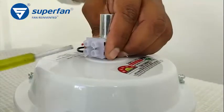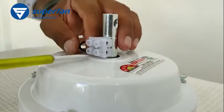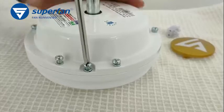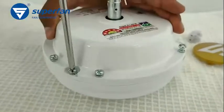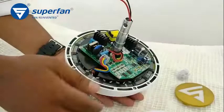The connecting wires from the electronics board must be disconnected before removing the board. Disconnect the phase and neutral wires from the terminal block. Unscrew these screws to remove the dome cover. Dismantle the motor's top cover by unscrewing all three screws.